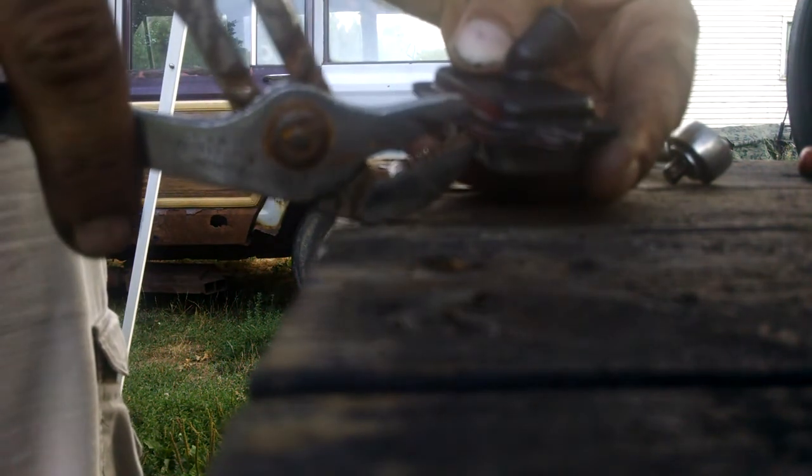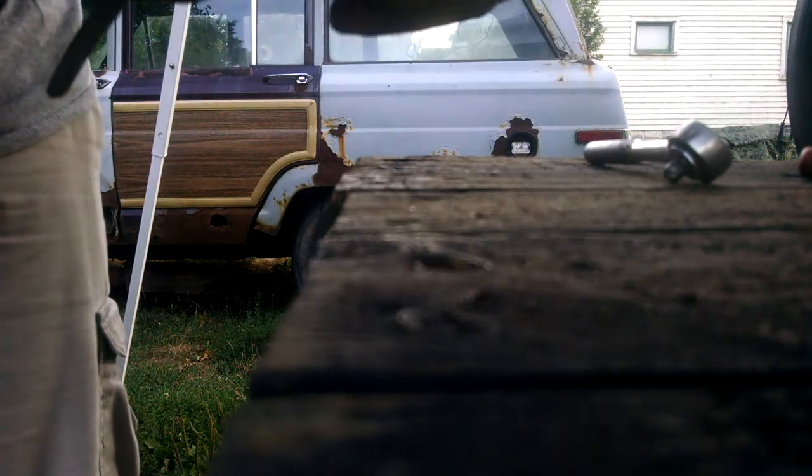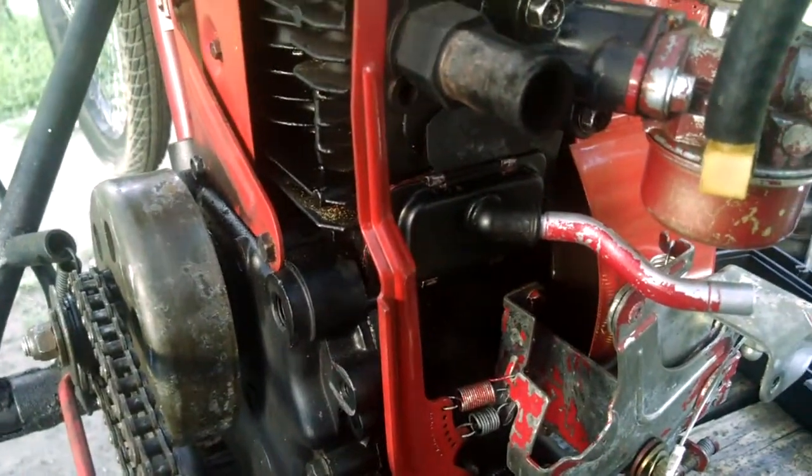Notice how I'm putting it together — the five holes are all on the bottom so no shavings will get in the motor, and the airline is on top. Just bend the tabs back. I didn't put sealant on there because the gasket's still good — nice tight fit around there so it shouldn't leak. I got the PCV valve back on the motor. All I have to do is finish putting it back together and that's the fix.